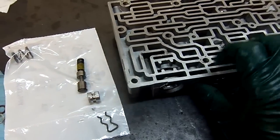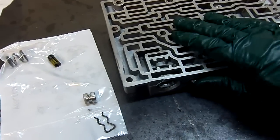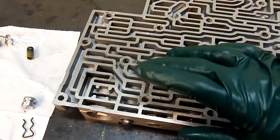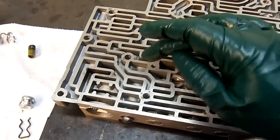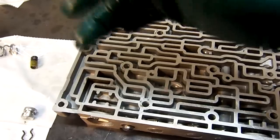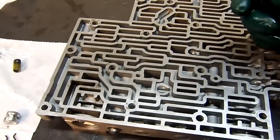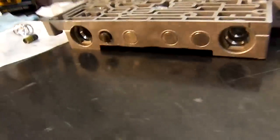What you want to accomplish with this: you eliminate the original spring, and then install the new spring, the end plug, and the clip. Basically, what that is doing is locking the valve so that it won't move, but you have both ends covered on the opposite end. You can also drill the plate, like I showed you in that other video. If you want to see the location of those holes, refer to that other 4L60E valve body video. But this is how you would install it.